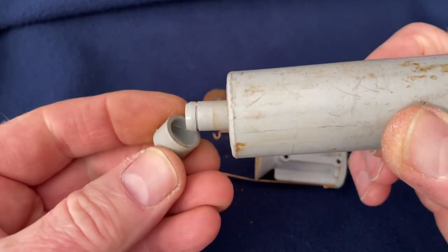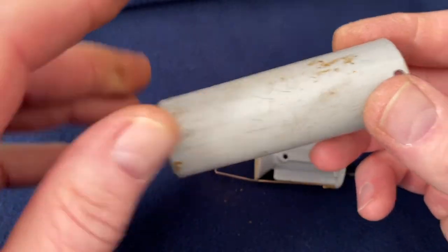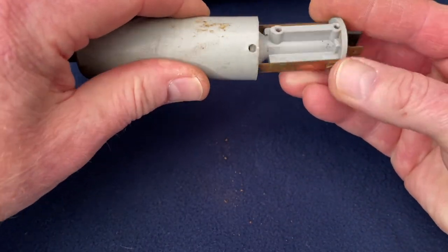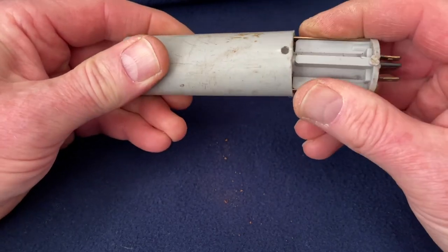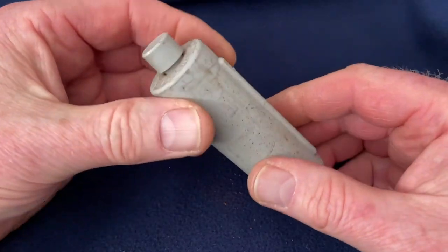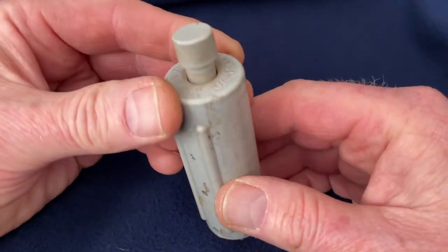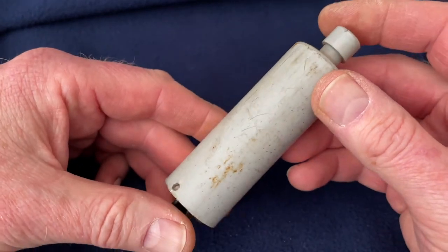To put it back together — very simple — you just refit the cap on top of the plunger, it's just a push fit, so that's now locked in place. Your ball bearing would go back in here once it's cleaned if you were to use it again, and it simply goes back in, realigning the pins. There's only one pin sticking out and that should push back into its recess — which it does. There we go, realigned. That's why it wasn't rattling earlier — the ball bearing is held down by that pin. Only when you go into a crash does it rattle, trip, and cut off the power. Very clever — and remember these are 1970s cars. This was so forward thinking. I hope that's been of use.